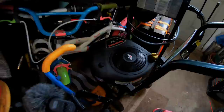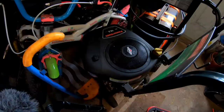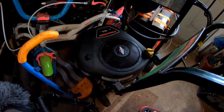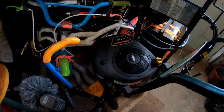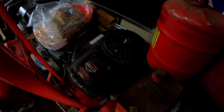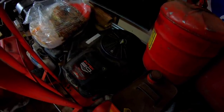How about that, huh? I actually have a lot of engines now. So I'll give you guys an update on the amount of engines I have. This is the 18.5 power built engine that I got from my local friend Mark from East Northport. He said it smoked. I changed the head gasket on it, and I'm going to try it when I get a chance. If not, I'll swap out the piston. You guys know about this 20 horsepower V-twin that I just replaced the push rods, rocker arms, did a valve clearance, replaced the valve cover, and replaced the spark plug after gapping.